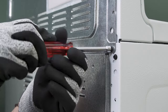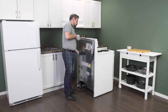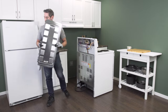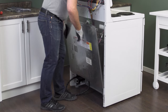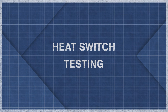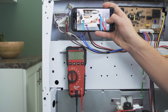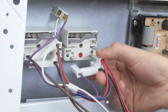To test the heat switch and the wires, you'll have to remove the back panel. Some models have a small panel near the top and a larger panel near the bottom. Now remove the screws. The panel will likely be sitting on several hooks — simply lift up to remove the panel. At the back of the stove, locate the infinite heat switch. To remember where each wire goes, it's best to take a picture for reference. Now disconnect the wires.